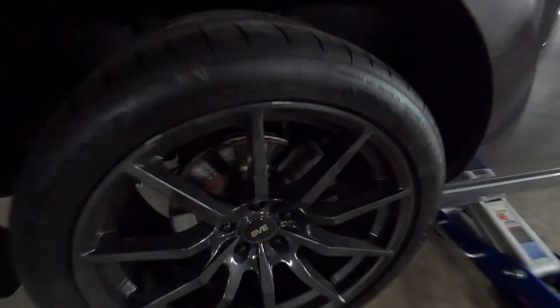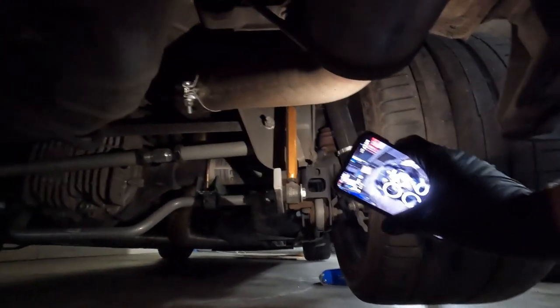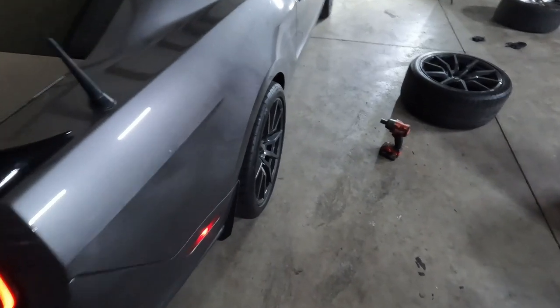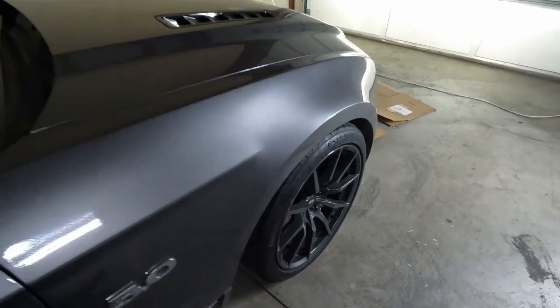I haven't lowered it back down on the ground yet, but it pokes out just a little bit. I'm not seeing any clearance issues at the moment — it's pretty dark in there but let me grab a flashlight — I'll use my cell phone. Doesn't look like anything's hitting on the bottom and doesn't look like it's rubbing on the coilover. This might just work. Got it on the ground now — I released the brake and I don't see or hear anything rubbing. Looks like everything's going to be good.